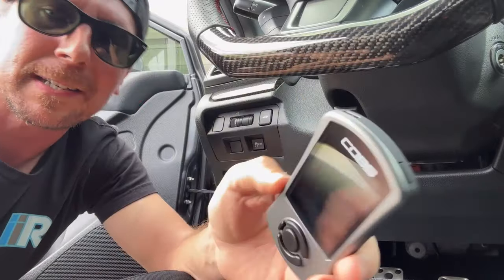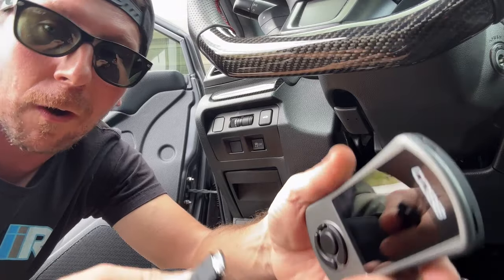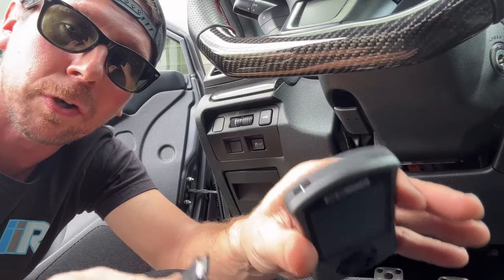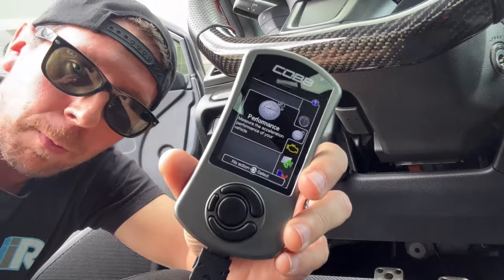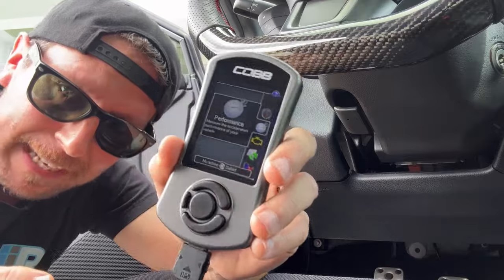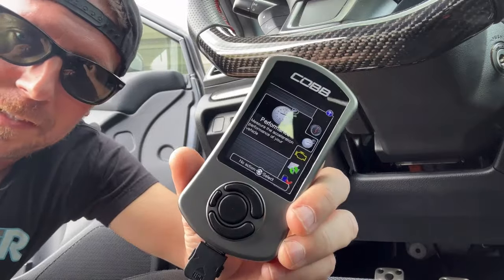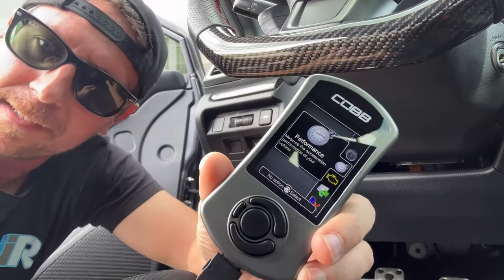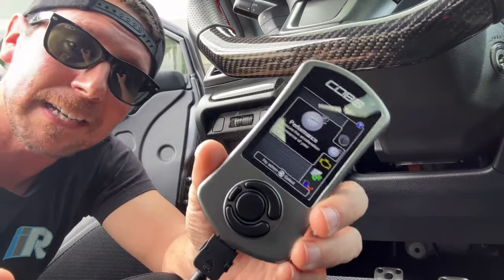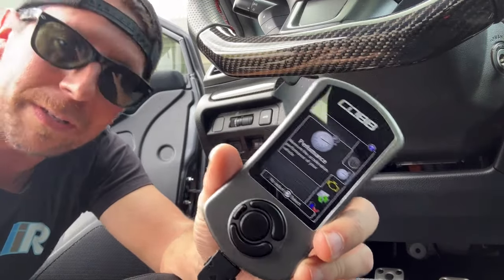My suggestion: if we're running a Stage 1 or Stage 2 off-the-shelf map with all the appropriate modifications, once you flash the car, make sure all the numbers are good. But after that, go ahead and disconnect it and put it in the glove box — that's pretty much what I do, unless I'm doing some pretty hardcore hits on the car. At that point, I'll take it from the glove box, replug it back in, and monitor everything I think is necessary to make sure the car is running well and healthy. The performance tab is also available, but I believe the Draggy's satellite data is much more accurate than the Cobb's performance data, since the Cobb relies on wheel speed and can show inconsistencies if the wheels spin.